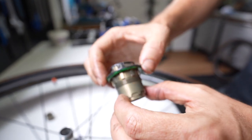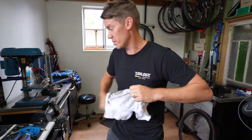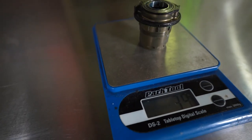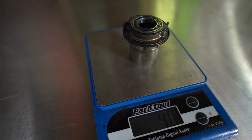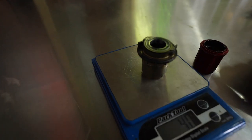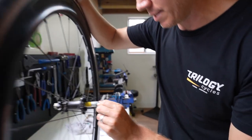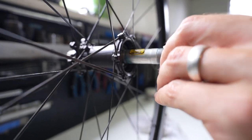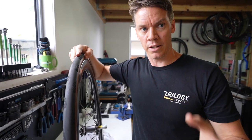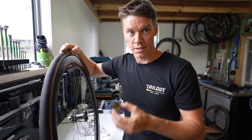The dust cap comes off, and the freehub is a little different — you'll see how quality this is. It runs an O-ring; this little O-ring is your seal and just holds everything in place. These are ultra-lightweight hubs — 146 grams for the whole rear hub. The front hub is 66 grams. The freehub body itself, with springs, O-rings, and two bearings, weighs just 40 grams — compare that to an older DT Swiss specialized freehub at 65 grams. Internally these run Enduro bearings, ABEC 5 style. There's a warning sticker: strictly follow the instruction manual, as incorrect greasing can cause hub failure. Heavy-viscosity grease will affect how the hub works and damage it — that's how refined these are.